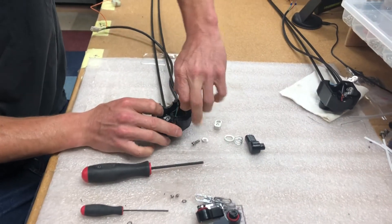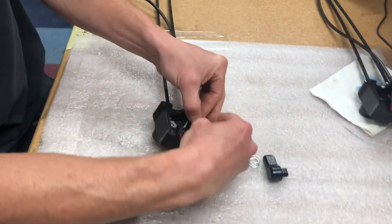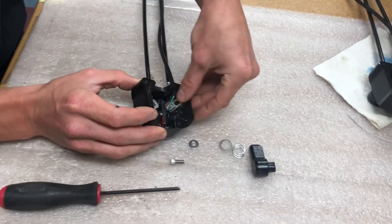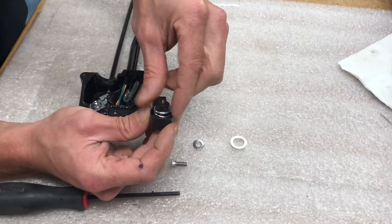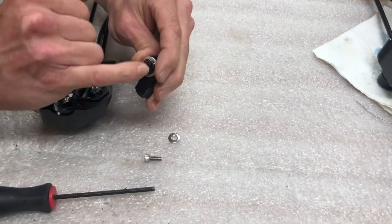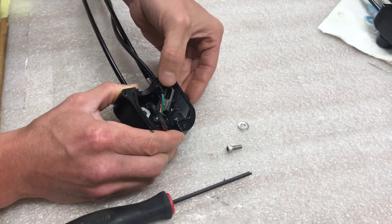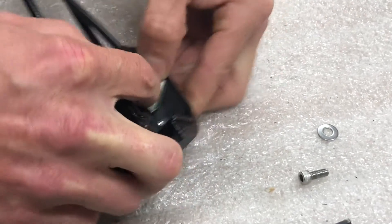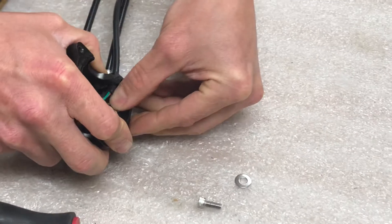Now onto the four-wheel drive lever. Put the cable inside the cable clasp and rotate it. Then take the knob, the spring on the knob, the spacer on the knob, and make the flats line up with the flats on the cable clasp. Push the knob in. It helps if you apply some pressure down on the knob so that it's pushed up into the housing.